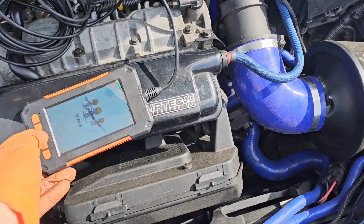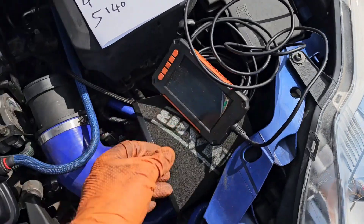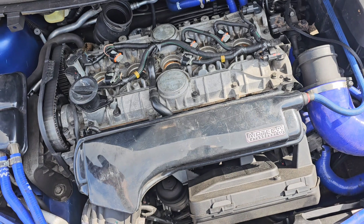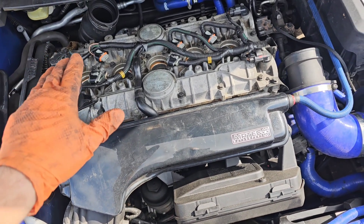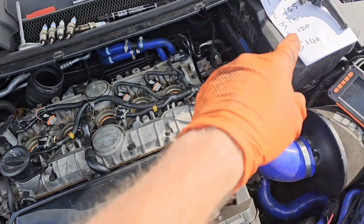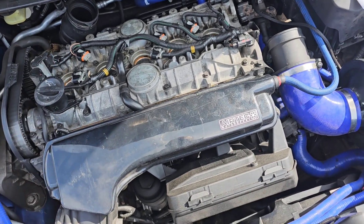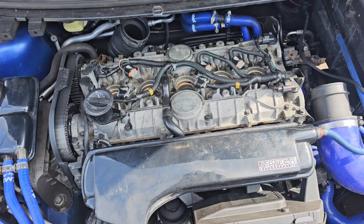Number five looks very oily so what I'm going to do now is a leak-down test. If you don't know what a leak-down test is: you pump air into the cylinders with the piston at top dead centre. You pump air in - I think it's around 30 psi - and with the valves closed it should hold steady. If you've got a leak, hopefully we'll see what the problem is. If you hear air coming out of the coolant, you know it's leaking through the waterways. If you hear it out of the exhaust, it's the exhaust valve. If you hear it at the inlet, it's the inlet valve. Or if it's the piston rings, you'll hear air gushing out of the crankcase or dipstick.